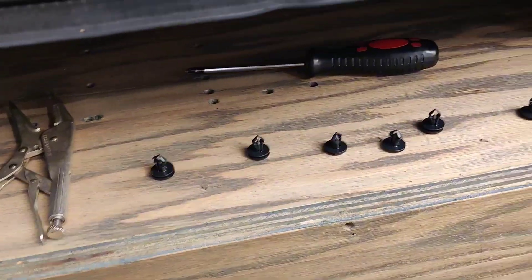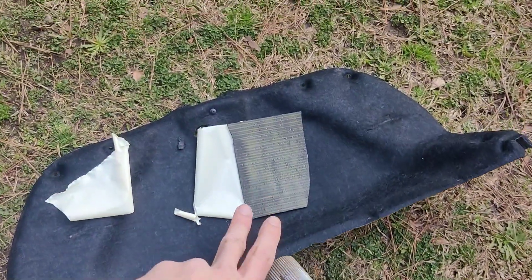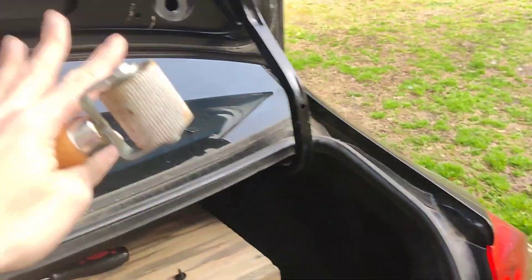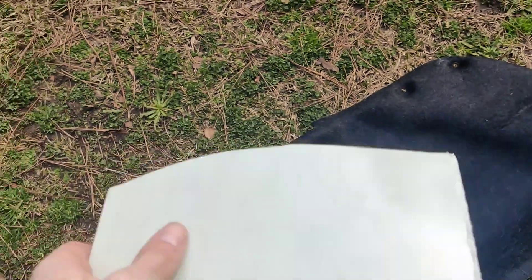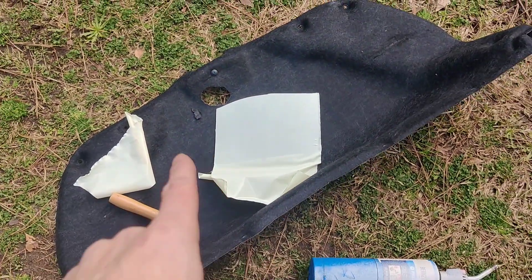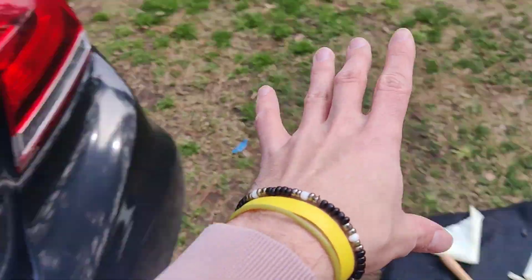We got the carpet out of the Honda and some of the clips out. What I did is take that one sheet, cut it up into pieces, and now we're putting it on the Honda. First thing you want to do is kind of heat up the side right here. You want to take this tape off — it's a tapish material and it's going to reveal the smooth and sticky side.